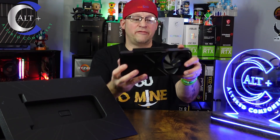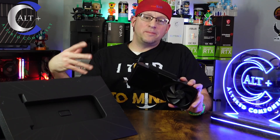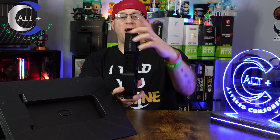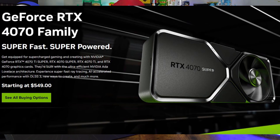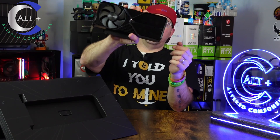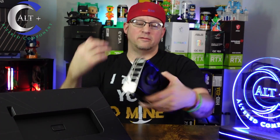Let's take this thing out and take a quick look at all the features. It's a pretty heavy GPU — let's weigh it. The GPU out of the box weighs two pounds and five ounces, give or take. It's a pretty beefy GPU for such a compact footprint — not a giant form factor like some others. That means the fin stack on this thing is very, very thick. They use the push-pull method: one fan pulling air through one way, one pushing from the other. Let's give it the old panda spin — that's a good GPU, some good blades. With only a 220-watt TDP, cooling should be no problem.